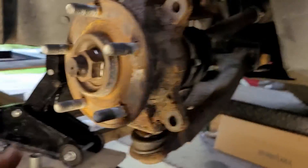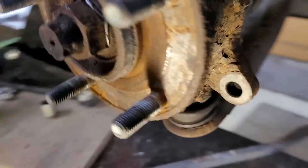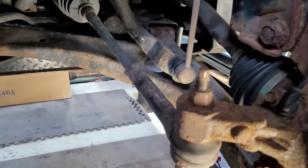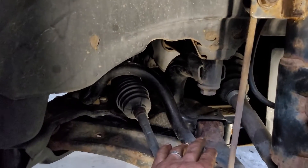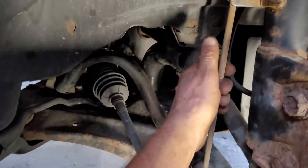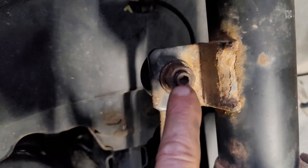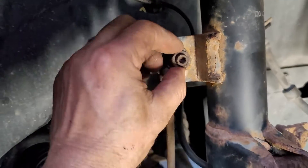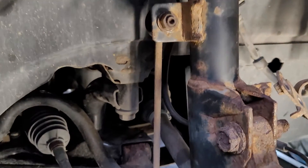You need to check that out — this is magnetic. Got my lower ball joint in, got the 18 squeeze bolt in and semi-tight. Got the tie rod bolt back in and tightened up — still need to torque it. Got the sway bar link in and tightened up. Remember that's got a — you're going to have to hold this with a number 5, going counterclockwise to get to a certain point when it locks up on the back, and then hit it with a torque wrench and get it torqued up.